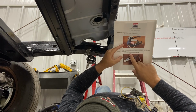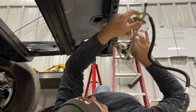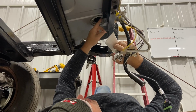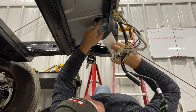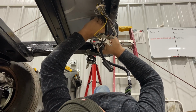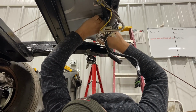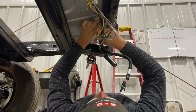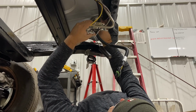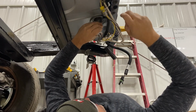Be sure not to tear the hydromat as it is being inserted into the tank. Okay, let's get a hold of it here. The hydromat, it's pretty stiff. That's pretty strong material. But that's also a pretty sharp edge. So we're going to be careful, and we're going to try to squeeze it and get it in the tank. I know it sounds like we're ripping the guts out of it, but this is the only way that it will go in. And just take your time, work it in the tank. Okay, now we got that.